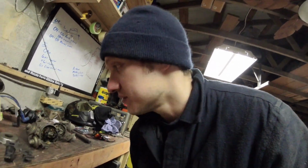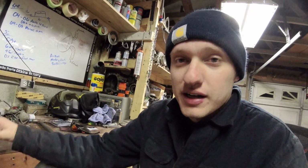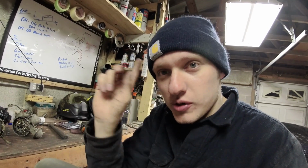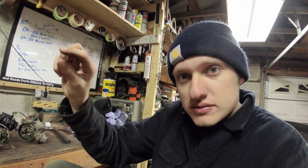I'm going to tell you how I set up the advance. Since I generally know, when you read the books and understand the stuff, that those advances are generally a maximum of 10 degrees, I normally set all my timing at idle. Okay, it's just easier. I don't have to hold the throttle and do the thing. I can do it with one person, right? So I usually set my timing at idle, even on a mildly stock port, at 10 degrees on the leading. Okay, that's about 1 centimeter, because Mazda's smart. The front pulley is 360 millimeters in circumference. So 1 centimeter, which is 10 millimeters, is 10 degrees of timing advance. So usually 1 centimeter advanced is where I set my timing. That's typically where a stock motor likes it.